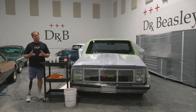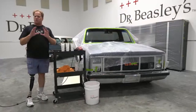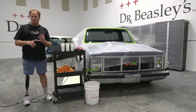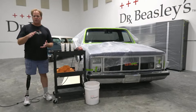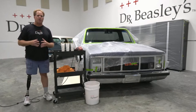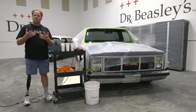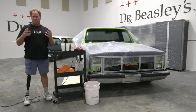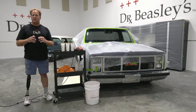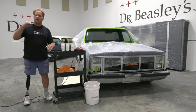And for the topic for this class, we're going to go over subsurface machine polishing. So there's two kinds of machine polishing glass. There's topical, and that's where you're removing things like water spots, drizzle stains, road film, or as they say across the pond, traffic film, just any kind of the gunk that builds up on the glass that you want to get off, especially if you're going to put a glass coating onto any glass. The other type of glass polishing is subsurface, and as the name implies, now we're going for defects that are below the surface or in the glass.